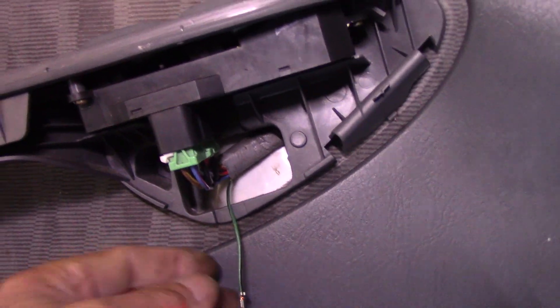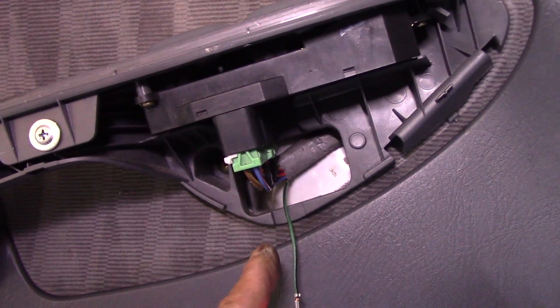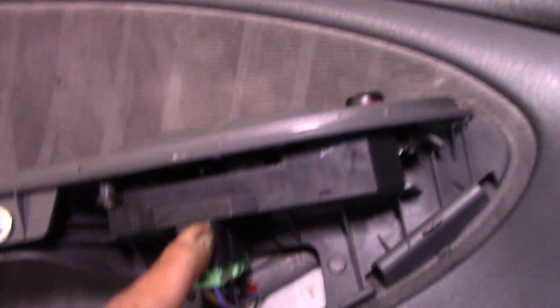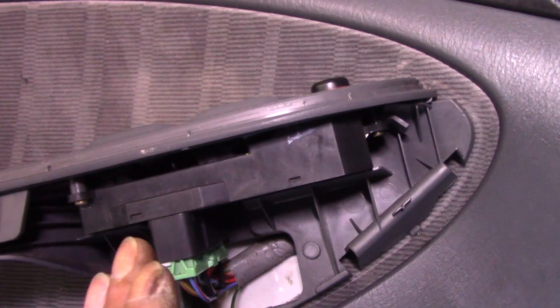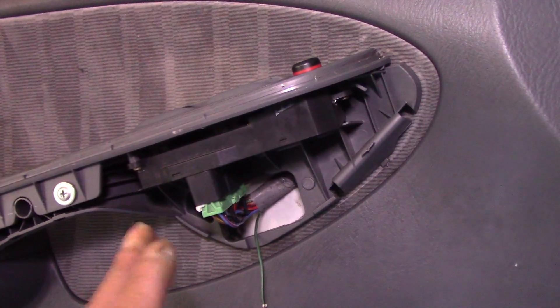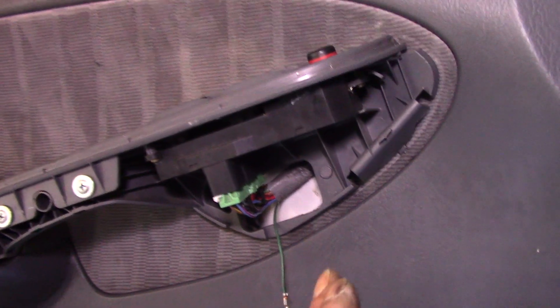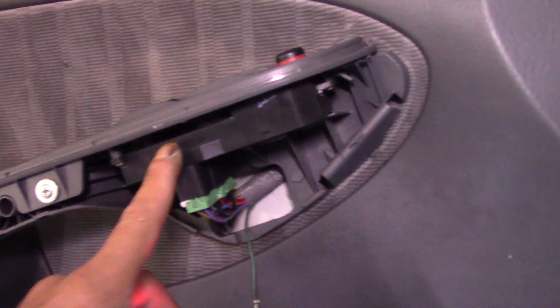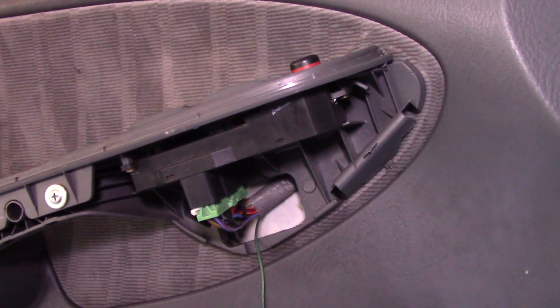Lucky for the vehicle owner it was not shorted to ground by the wires. If it had shorted somewhere, you see these wires go all the way to the fuse box, all the way to the passenger window - if it shorted somewhere, it's super super hard to find and locate where the short is. But in this case, I know this switch costs some money, but it's better than paying a mechanic to find it. That's it, guys. When you have a problem with your car, you have a clue of what to do - you might find the problem faster and easier. Why I removed this wire was to test for two things: short to ground by the wire, and also to confirm the window what he told me was correct - the window working fine. And we don't have a short to ground by the wire, but we have the bad master switch. Okay, that's it guys. Thanks for watching, see you guys next time. Bye-bye.